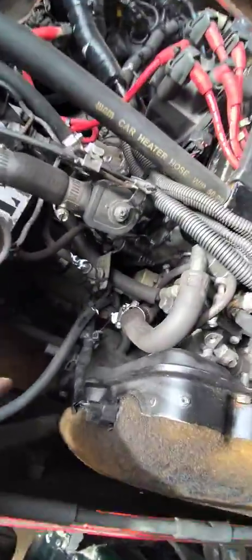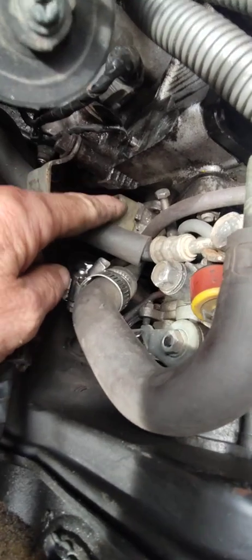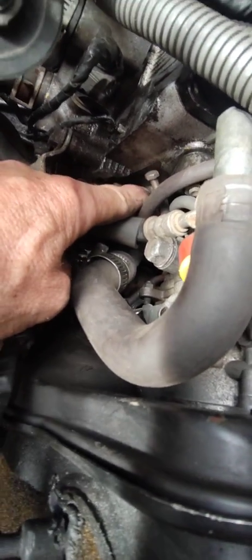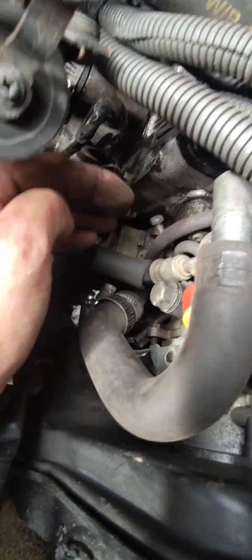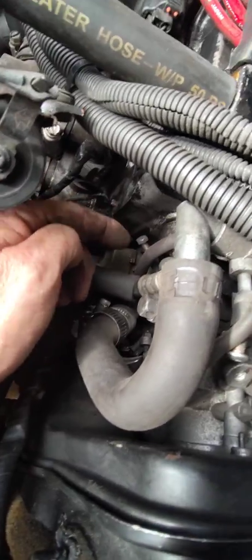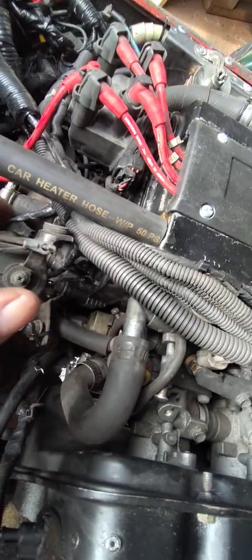When you come across to the car, you have your throttle bodies here, and underneath you can see the little grey device — there it is, bolted to the cylinder head. On a Toyota 4AGE it's not getting water supplied to it; it's getting thermal transmission through the alloy of the head from the water jacket, which heats the bimetallic spring and brings the idle down.